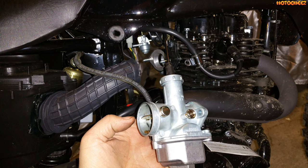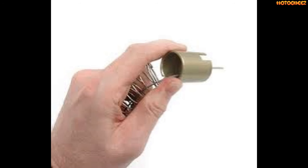The pipe that comes from the airbox is pretty rigid, so it's going to take a little bit of maneuvering to get it out. Next you're going to want to remove the plunger, which is directional, so pay attention to which way it goes in. There's a slot on the plunger and there's a pin inside the carburetor that has to line up. The other side is the actual idle adjustment.